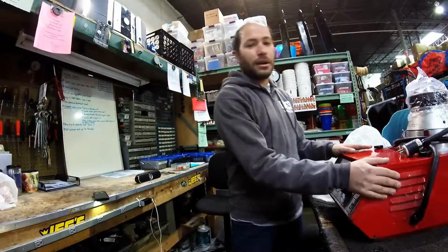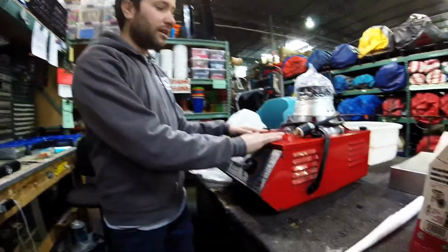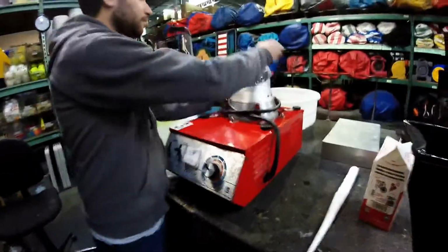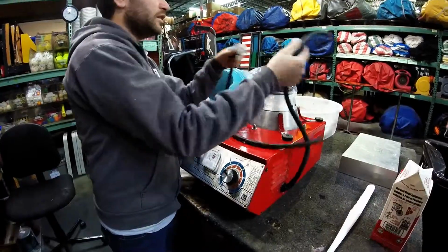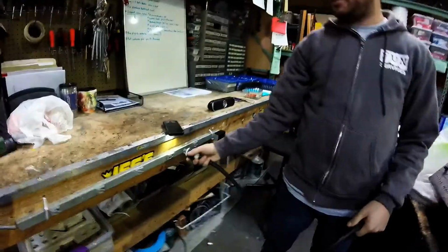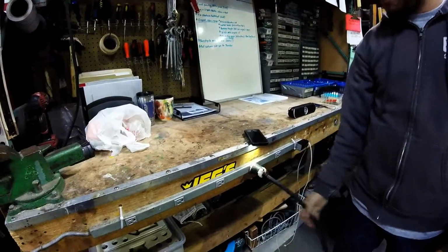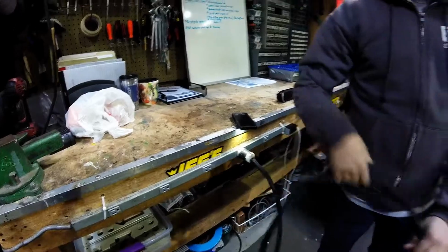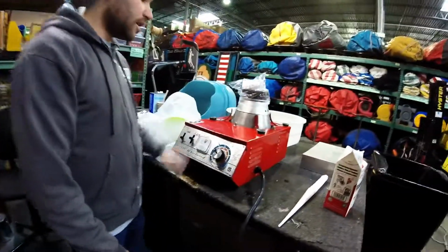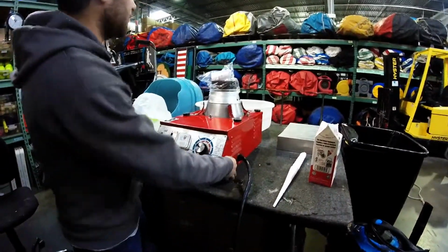So we've got the cotton candy machine in the spot where we want to make cotton candy. A table, a countertop, a flat surface works best. These draw a lot of power, so it's best to always plug them directly into an outlet, not running them on an extension cord. Running them on a weak extension cord will not generate the amount of power it needs to heat up properly, thus not making cotton candy and ultimately ruining the machine itself.